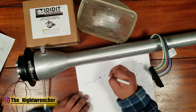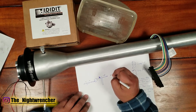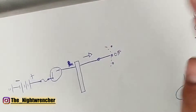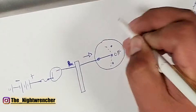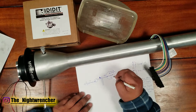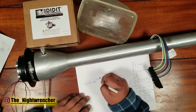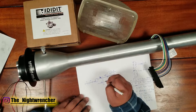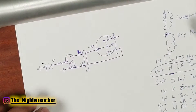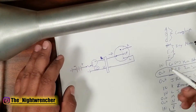From the turn signal switch, we run a wire out for right and a wire out for left. From there we continue to the left front turn signal — pin H — which goes through the connector, straight to the light bulb feeding your turn signal, and after it leaves the turn signal it goes straight to ground. If you've been following along with the last four videos this should look pretty familiar; if you're a little lost I recommend going back and watching those.